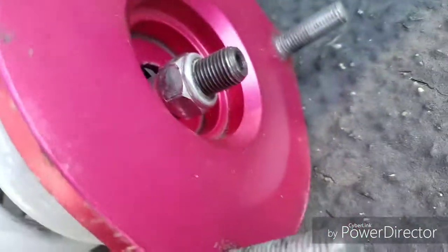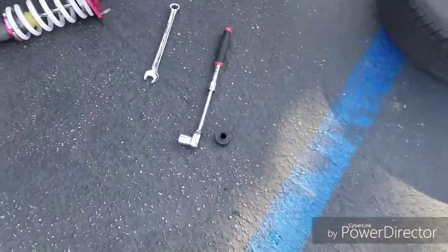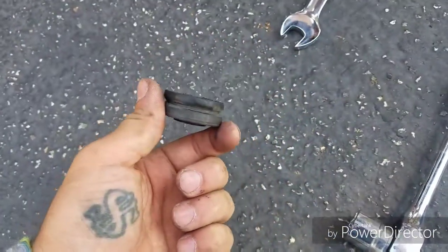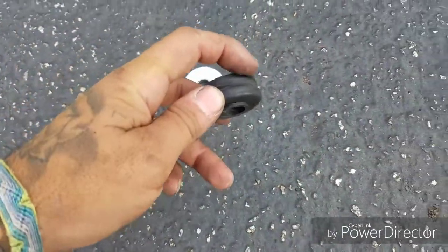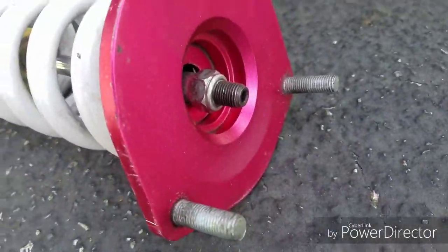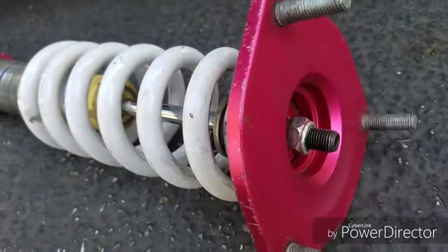On the way to Shane's house to work on my front suspension, my rear basically didn't blow but it came apart. The whole top hat — the bushing right here came out, all because this washer is supposed to sit on top of it, and then this is supposed to be literally inside the top hat, and it came apart as you can see.